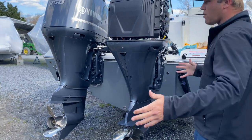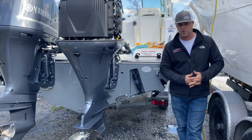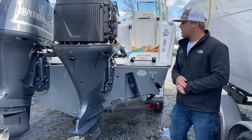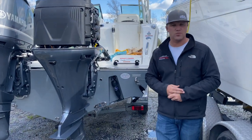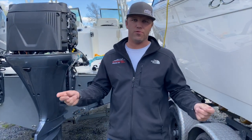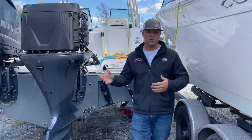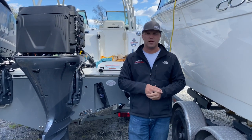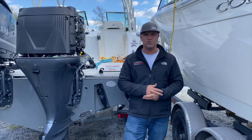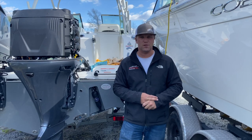So to recap: 10 hours, vary your RPMs. 25 hours, your first full service oil change. 100 hours or every year after that. As always, if you have any questions about anything we've covered in the video, please feel free to call 302-436-1737 or email myself or Joe here at the shop and we'll be able to take care of anything you need. Congratulations on your new purchase — if you need anything, please don't hesitate to call.